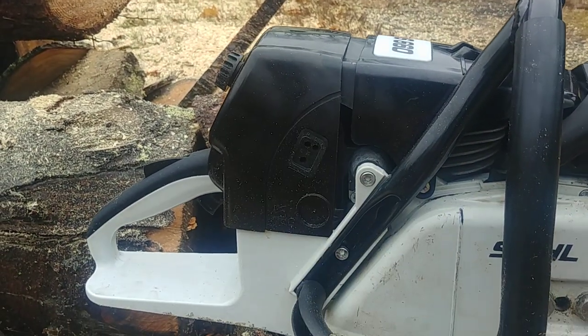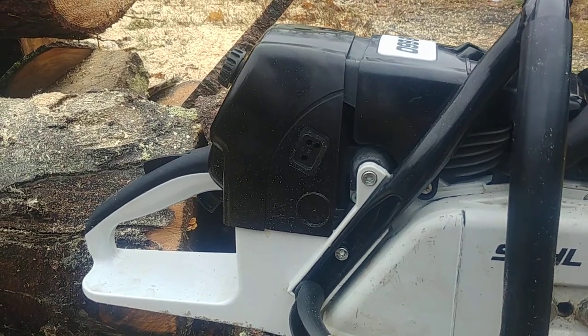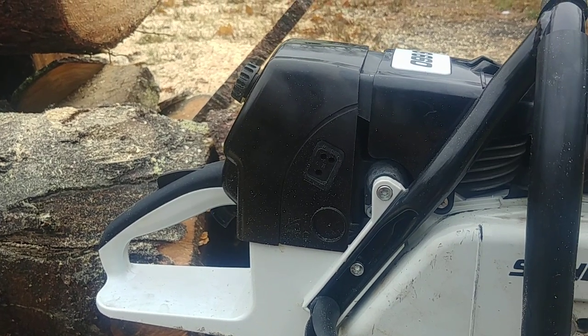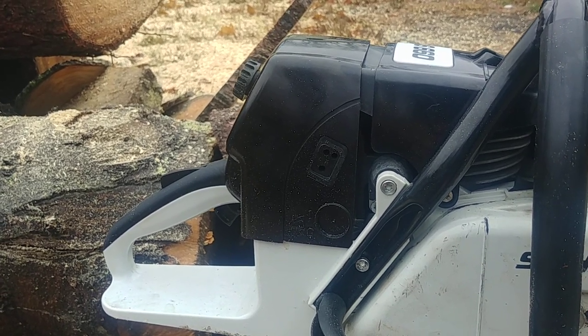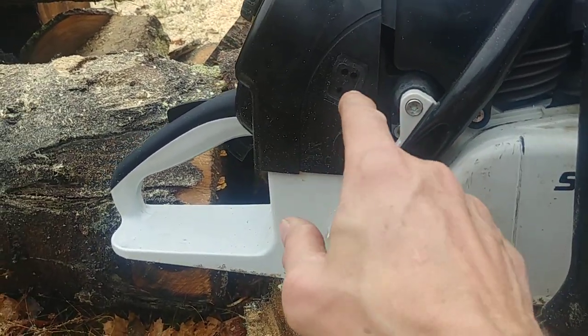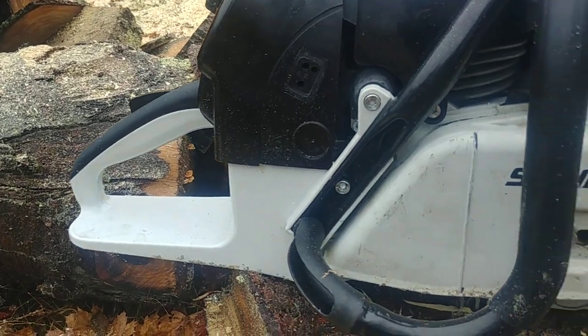As far as the covers, I dyed them with RIT black fabric dye. You boil them in water on the stovetop at 180 degrees-ish, just less than boiling. Don't boil it, for about 45 minutes. They come out, it blacks them all the way through. The dye goes all the way through the plastic, so you can't scratch it and see orange again.